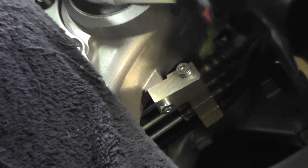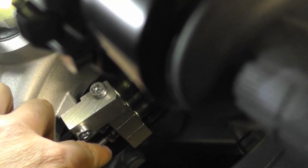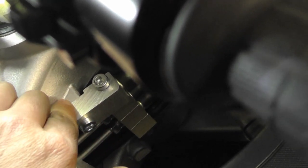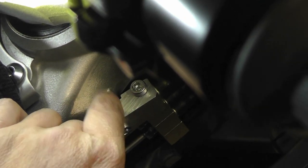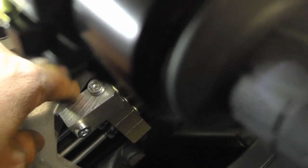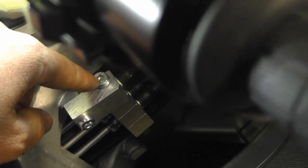The block is in. This was a pain to install. What I did was install this screw into this bracket first because I had a hard time aligning it and seeing where the bolt lined up, so I installed this first and then this second — it was a little easier. Pull this out, use a flat head screwdriver for some leverage, and use an Allen wrench to line up the holes so you can get the bolt in.